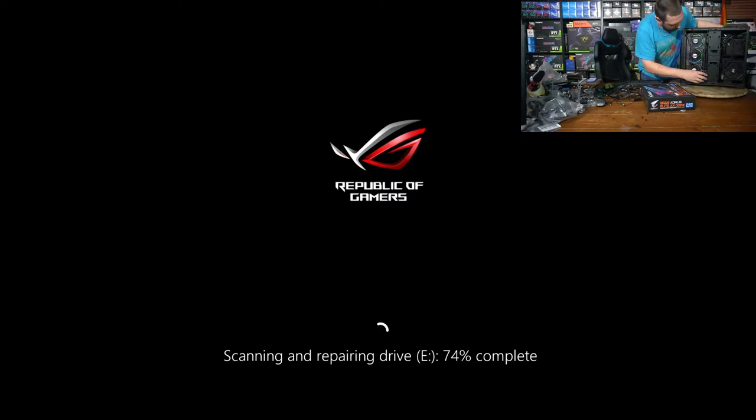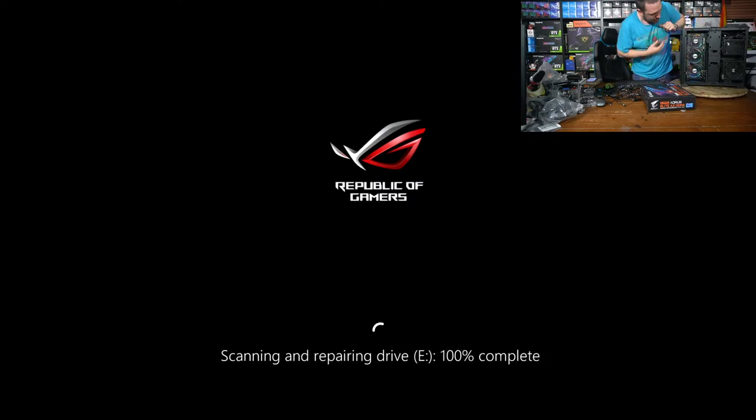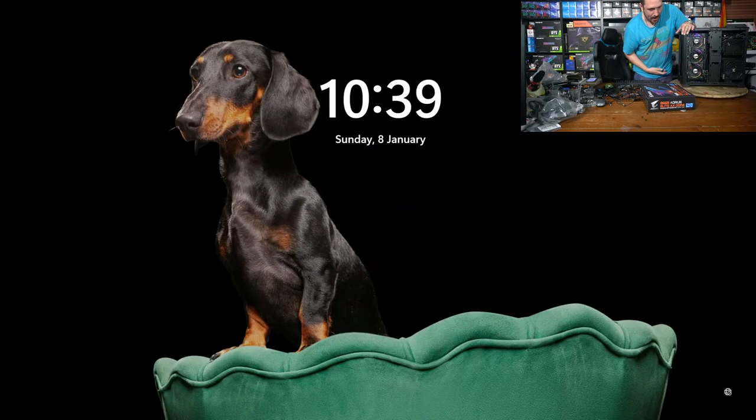Okay, so just FYI, Jack, if you have any issues with one of the RGB fans stops lighting up, you've got your three RGB connectors tied down there so they're accessible, and the other three are up there. They're just sticking out like that so that they're accessible. The rest of the stuff can just get tucked away back here. And yes, that's what I mean by the Lian Li. If you've got to swap out a fan, it becomes a nightmare. So what I try to do is wire it up so it's easy to work on in the event that you have to.